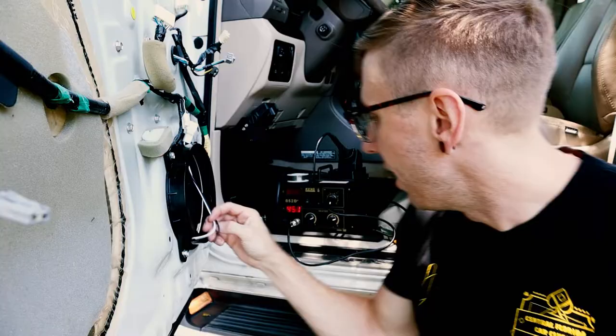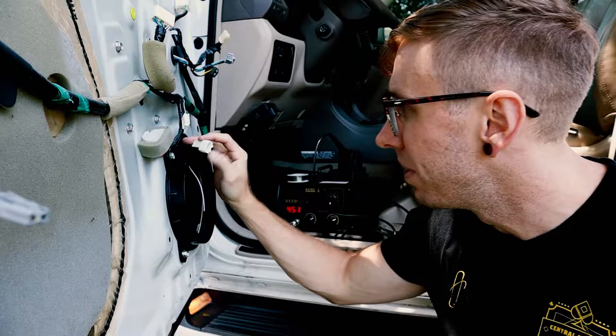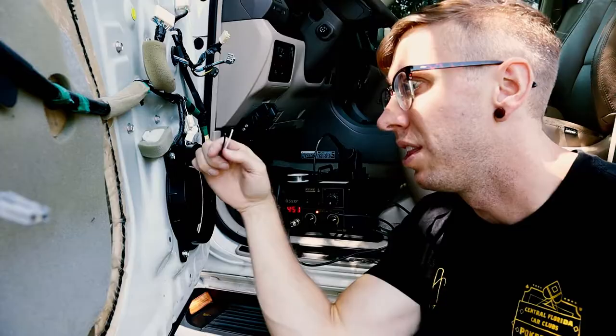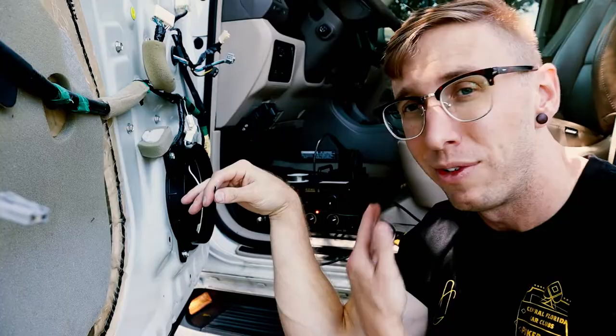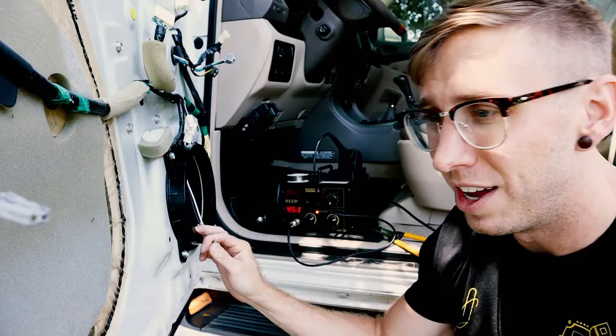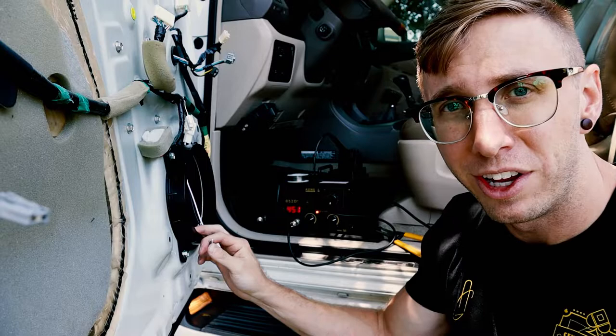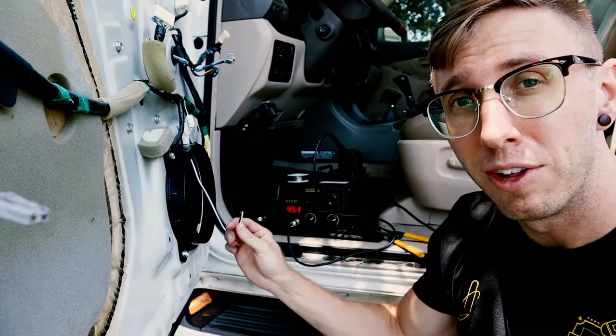The adapters have been cut off. This clip is the correct adapter to fit into the harness, but the prongs for fitting onto the speaker terminals are not universal and don't fit the speakers I have. So I'm going to cut those back and use my soldering station - just heat the solder up and get a better connection. I didn't trust fidgeting with and modifying the existing ones and risking a poor connection or them falling off.